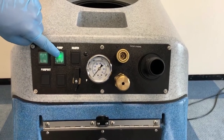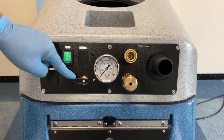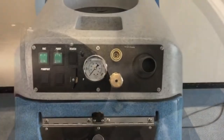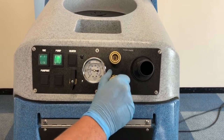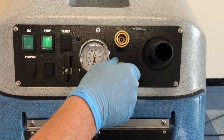When starting the machine, turn the pump on and turn the priming valve switch to the horizontal position. This will clear any airlocks and make sure the solution from the clean tank flows through like so. To adjust the pressure on the Endeavour, turn on the pump, then use the pressure regulator to set the required PSI prior to cleaning. It will display on the gauge like so.